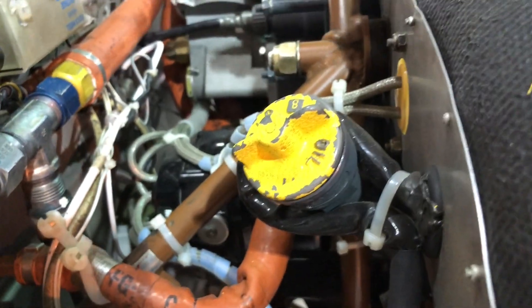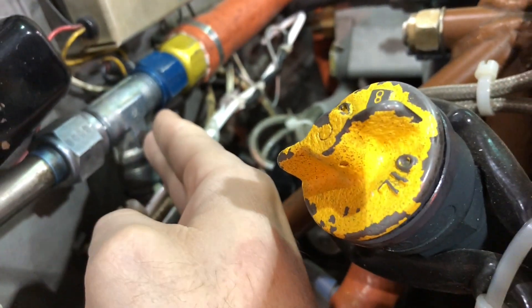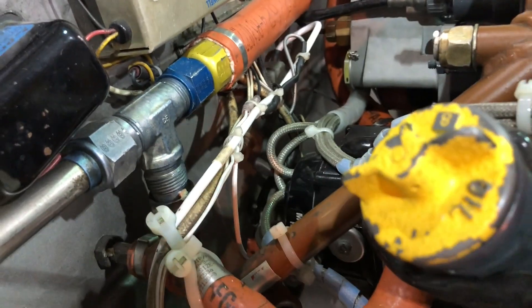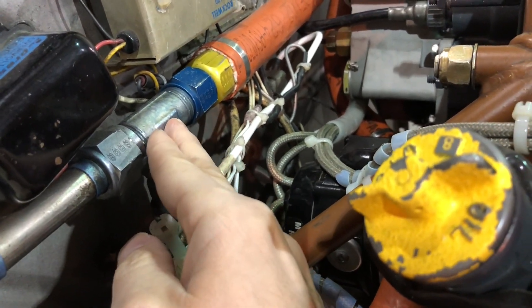Now when we go upside down, this becomes the new bottom of the engine. So we take our oil running up through this tube and we put a T in here. We're taking the oil out of here — which remember, this is now the bottom of the engine — and running this tube down here. It's this metal tube right down here, which comes down into our valve.